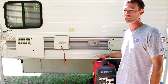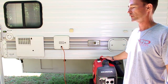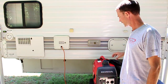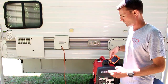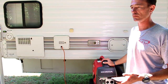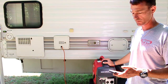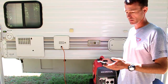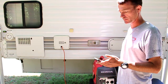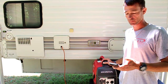This is how I measure when I need to do maintenance. Every 100 hours I have to change the oil. Every 200 hours I have to change the spark plug, clean the spark arrestor, and clean the fuel filter. I also keep track on the notepad on my phone. My notes include: engine oil every 100 hours or six months, air filter clean every 50 hours or three months, spark plug replace every 200 hours or one year, spark arrestor clean every 100 hours or six months.